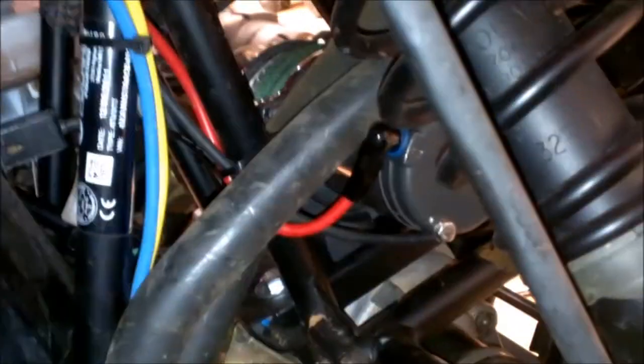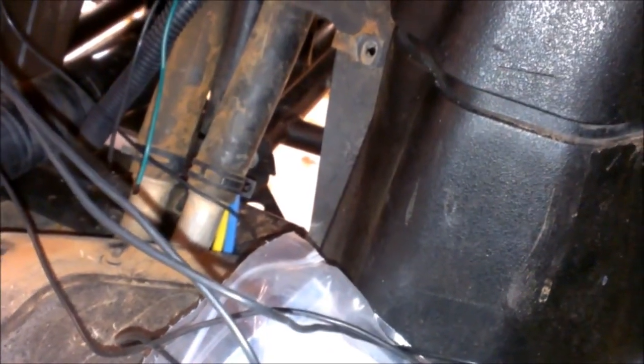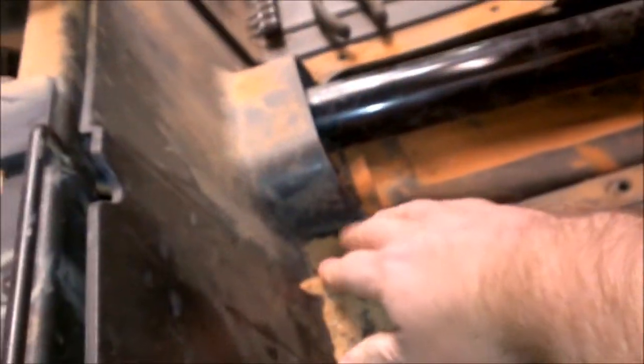I rerouted a couple of things — I still have red and black coming off the winch going to the contactor, and I ran the blue and yellow out through the floor, strapped off so they come in through the same hole. Blue, yellow, red, and black all come in the same hole and go over to the contactor. I made sure the wires from the battery don't come in contact with the driveshaft — I strapped them off down there and again underneath the seat belt boot, then fished them over to the battery.